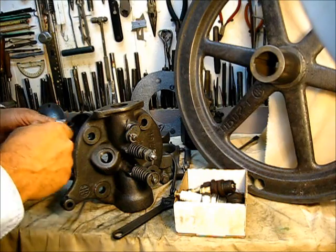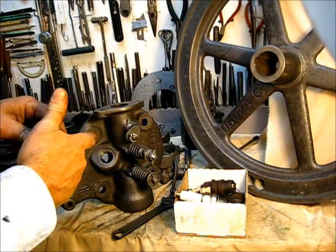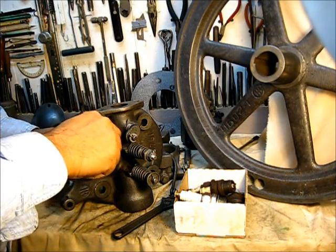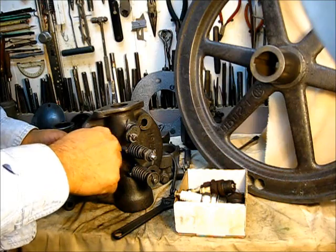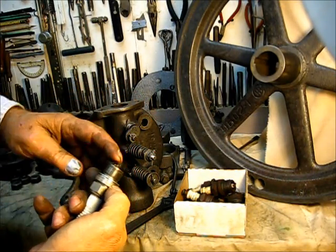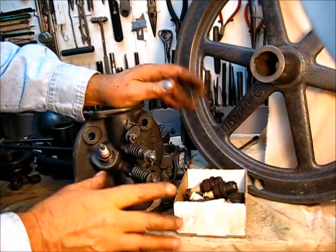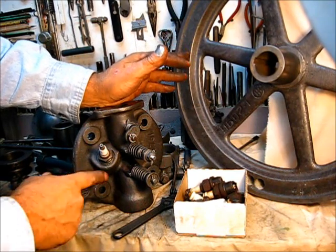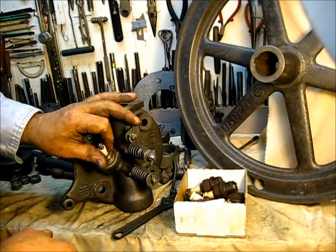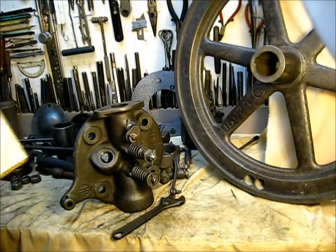In this head, if you put your finger down in there you can easily determine that the flame should go straight back. So what you do is put a little mark on the plug, screw it in until it bottoms out, tighten it up, and see where your mark is — where that little electrode finger is pointing. If it's pointing up toward the head, that's a bad position. You can't expect to get 100% out of that plug. The way to fix it is to put an extra washer in there — they do make indexing washers, which are just different-thickness washers. Do the legwork on it and you'll educate yourself on spark plugs.